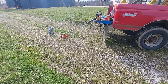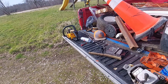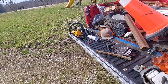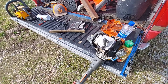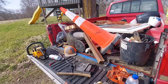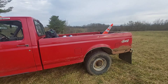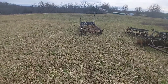Had a little bit of difficulty — I could not get that one to run. Went through the fuel lines, cleaned the carburetor, still no luck. I don't know what the problem is with that one. I'm gonna try and get this trimmer back together and see if it'll start. If not, we'll continue on with some other stuff and put the sensor on this truck still. Alright, I got the truck fixed — got the MAP sensor put on, took it for a test drive, it done pretty good. I'm happy about that, but I couldn't get my saws running — that's kind of disheartening.